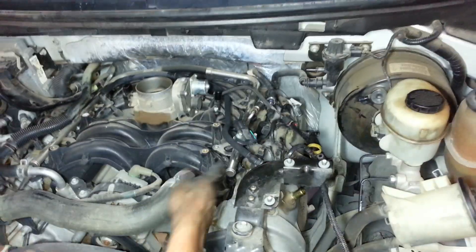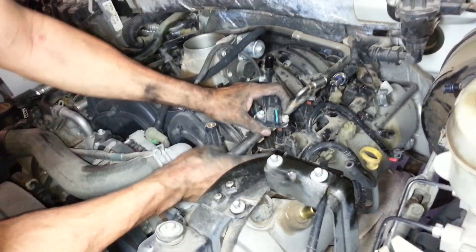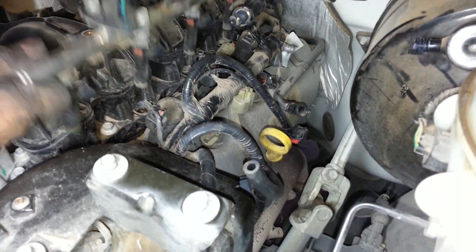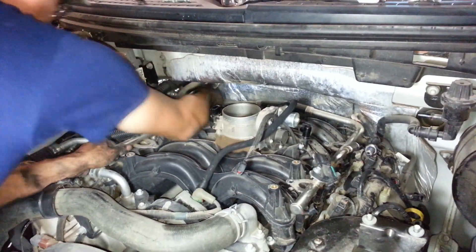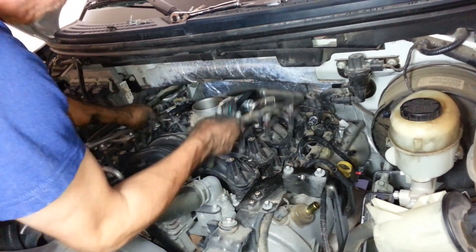As you can see, look at all the space you have right here to get to the fuel injectors. Since we've already removed the screws, all you do is look at it very carefully to make sure you don't break the fuel injectors. We've got it disconnected — all you do is wiggle it a little bit and they come right off. Do the same thing to the other side, and they come right off. Since we've got all the fuel injectors disconnected, the fuel rail comes right off.